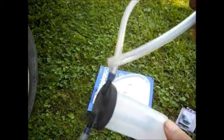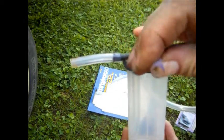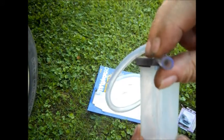This goes to your pump so you can work away from your area and have plenty of room. This barely fit up behind my brake drum, backing plate, leaf spring, and everything, because I need to get another piece of hose — because this stuff will collapse. If you don't get the right hose, it will collapse. This sucked shut on me because the bleeder was clogged, so I wasn't getting anything. I had to take the bleeder out, put a little wire through it, and clean the hole.